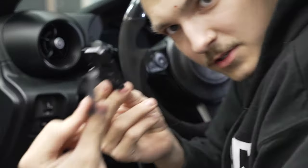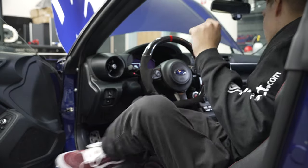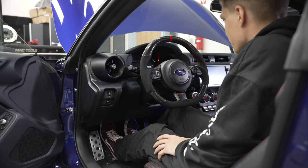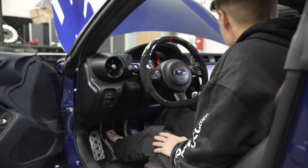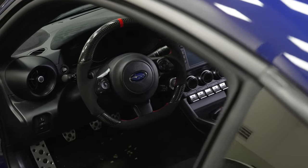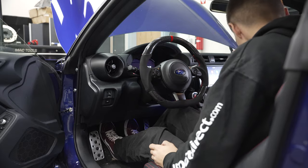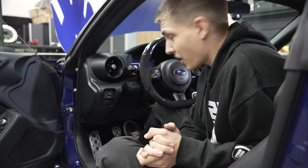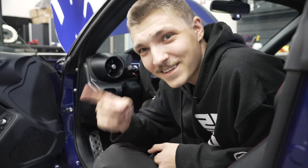Then just put your access panels back and reconnect your battery. Make sure no lights are illuminating. The airbag light turned off, which means we're all set! Now this thing is going to look better and feel better — oh man, yeah, this is lovely. Well, thank you for joining me on this journey. I hope you guys enjoyed today's video. If you did, consider giving me a like, and as always I'll see you guys in the next one.